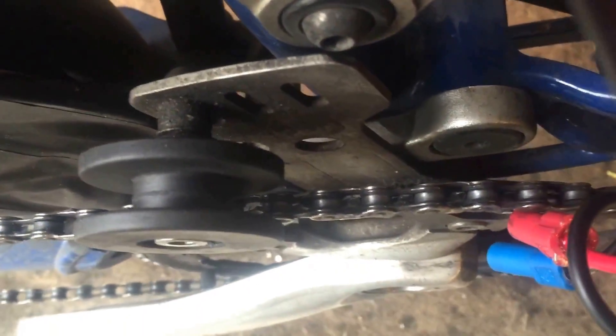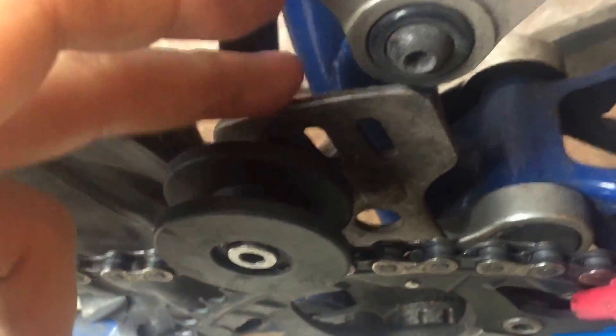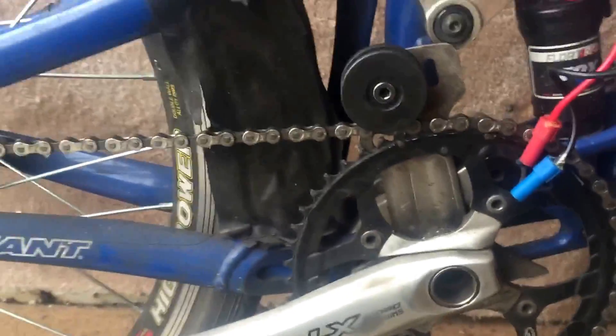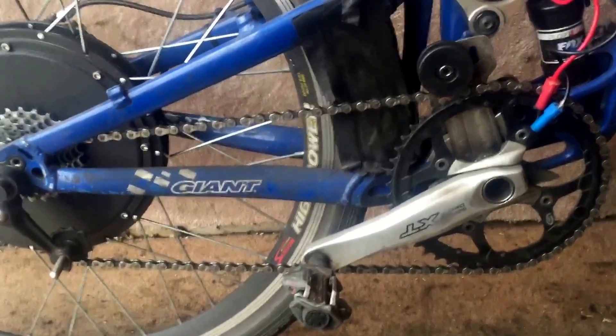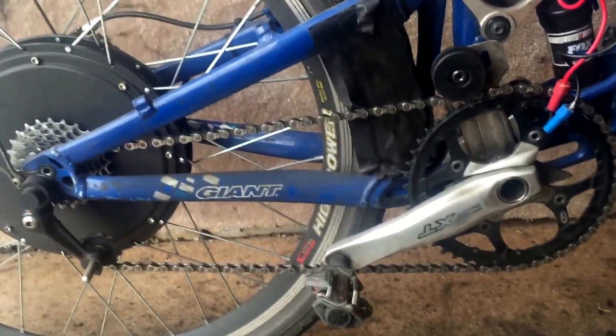So I put this little chain pulley on here, similar to what you get on a downhill mountain bike. This aluminium bit here — you just take off the bottom bracket and fit that in where the bottom bracket goes, then you get this round pulley, and if you put it just behind where the chain goes on, it stops the chain falling off. That's the last thing you want when you're going fast, trying to pedal, and hit a bump and it jumps off. So just a few tips — thanks for watching, see you next time.